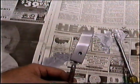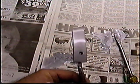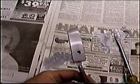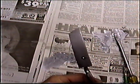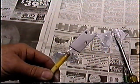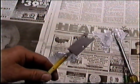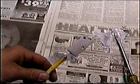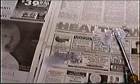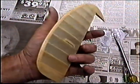Oh yeah, a couple of the little test parts here, and while these are drying, I can get a real good feel for if I'm going to have to add retarder or not. And I'll do that while I'm masking off the body of the mainframe. Now even at 20 pounds, this is just fine. So we've hit it right on the mark with the first one here. While these are drying, we'll do up the mainframe.